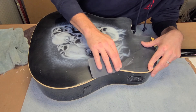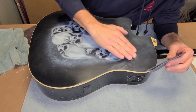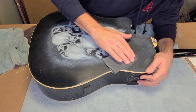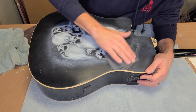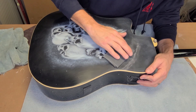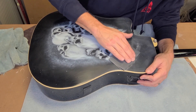You don't want to go through the undercoat or base coat of the black. Basically you've got a little lip right there and you want to try to make that a nice even ramp - feather it in, as they call it. Instead of going across it, for the most part you want to be perpendicular at 90 degrees to it, because you're trying to knock that edge down and smooth it into the base coat.